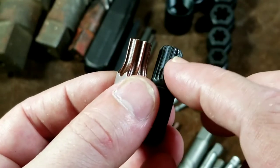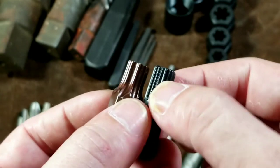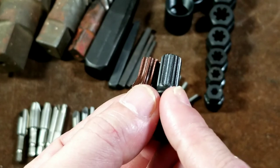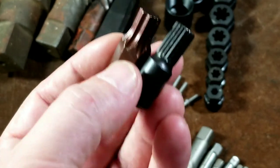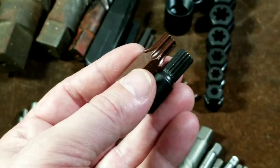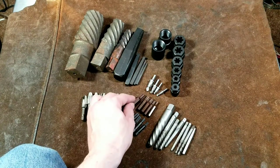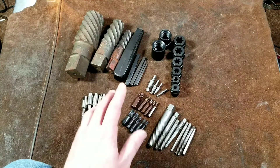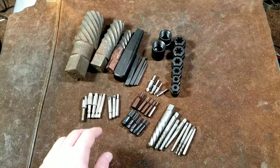The Achilles heel of these spline-type extractors is that once they get into the fastener, it has to be pulled off and can be very difficult. Usually you're putting this in a vise and using a chisel to hammer off the bolt. But they're totally invaluable many times because they're just really compact. And that's the end of my extractor series. We've talked about quite a few different extractors and we'll be moving on to some new kinds of tools in the next videos. I really appreciate everybody watching — please subscribe. Cadis Maximus out.